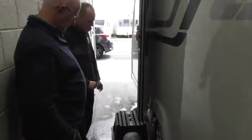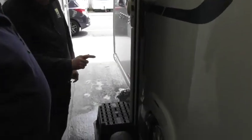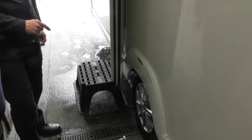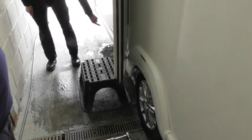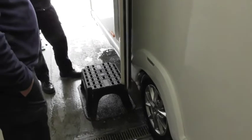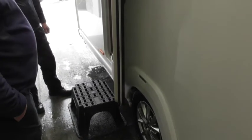This is something you're likely to do before you go away. I'm going to check the wheels afterwards, but it's very important that you check them regularly. It tells you on the plate here, 130 newton metres if you have a torque spanner. Otherwise, just tweak them to make sure they are tight.